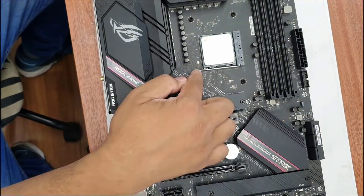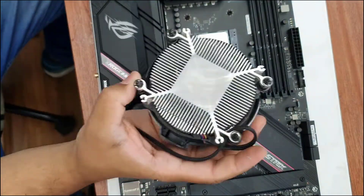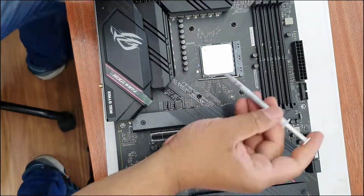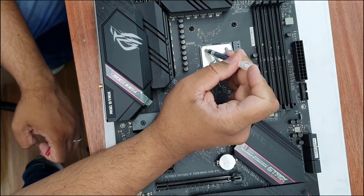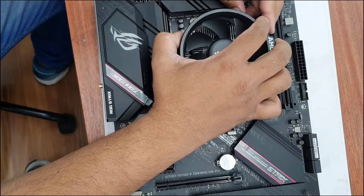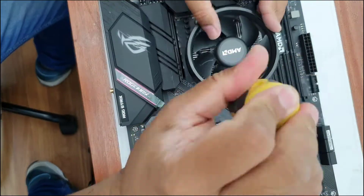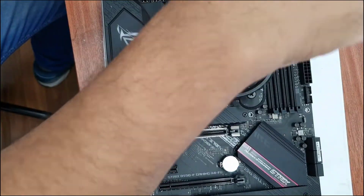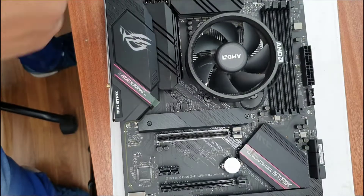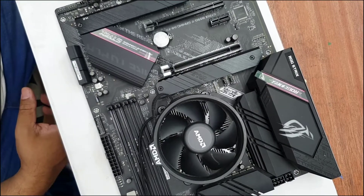If you want to upgrade your cooling fan or cooling system, it depends on which system you want. If you want to use the same old CPU fan, make sure you clean the heat sink before you reapply any thermal paste. I believe applying thermal paste in a crossway pattern is the best option — spread it equally on top of the CPU. When you tighten the screws, be careful, don't tighten too much. Do a cross pattern: start with the first screw, then do the opposite side, skip the second one — in that way the CPU sits properly and the alignment is correct. Don't forget to reconnect the CPU fan.